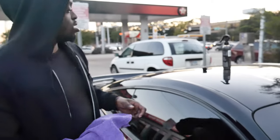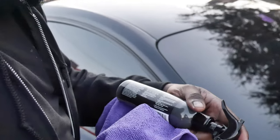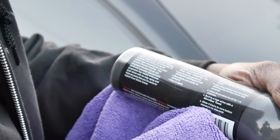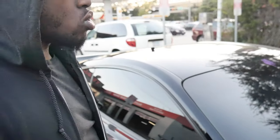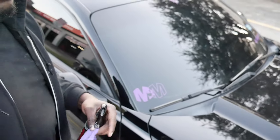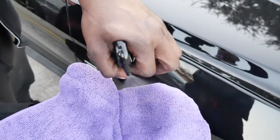Now what you're supposed to do is go ahead and follow the instructions. Spray Shine Armor on a microfiber towel, rub the product onto the paint, allow the product to fully cover the surface, let it sit about one to two minutes, then buff it out with the microfiber cloth. So what we're gonna do — instead of doing the plastic piece, it says it's gotta be on the paint. There's a little bit of dust on the paint from the polish, so we're gonna go ahead and do the paint instead. Get that good spray down on there.